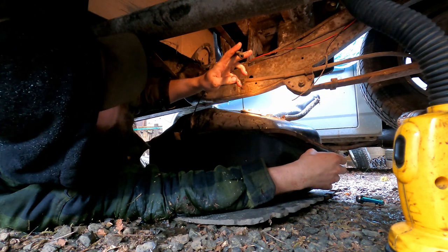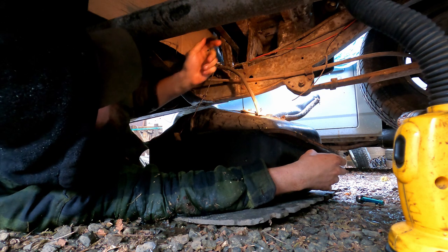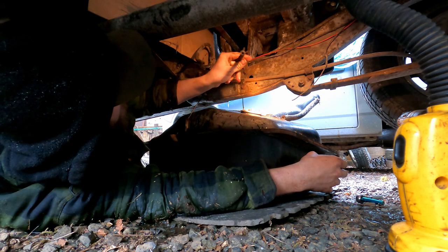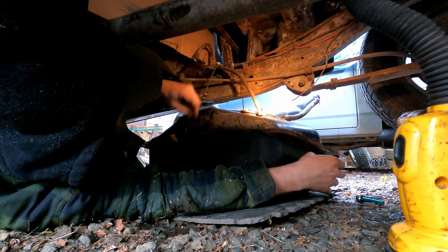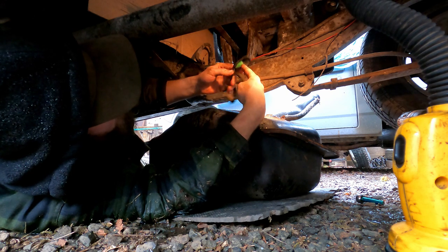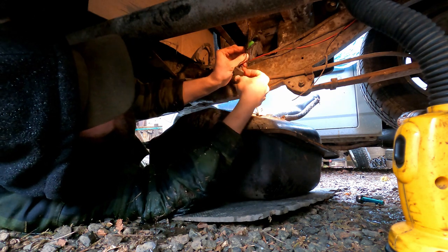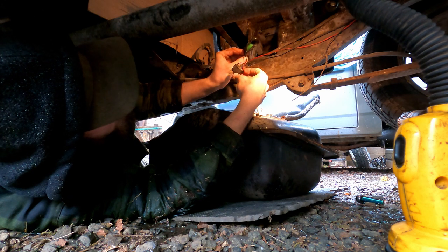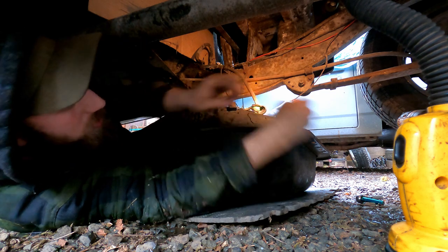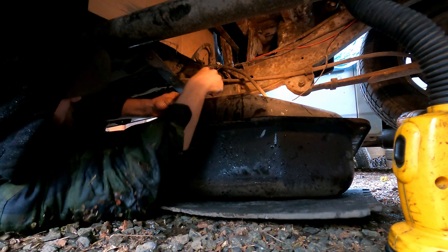There's just going to be your fuel lines right here — that's your feed line that goes to the pump, and then there's this one which goes to the top of the tank, that extra hose. That's your power wire, the green wire in this case. And then this guy actually goes around one of the bolts that holds down the fuel pump assembly, so I've got to take that apart really quick and mount it in.